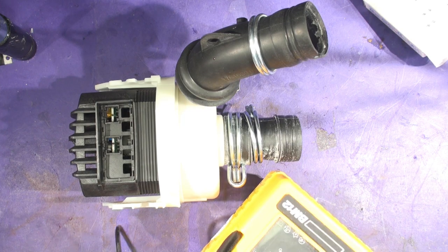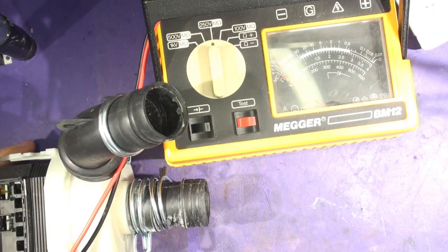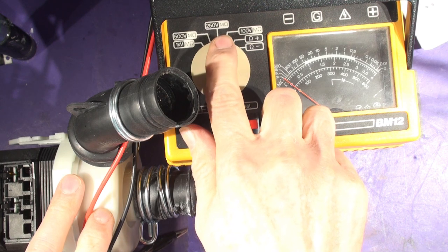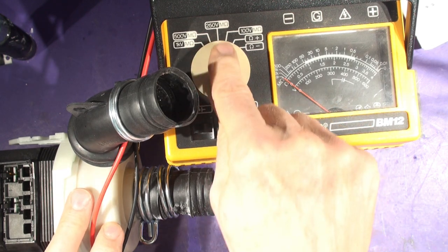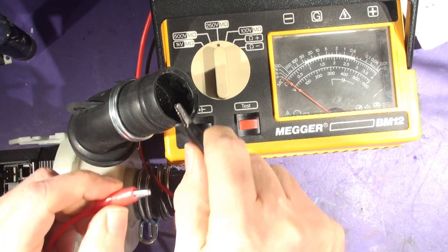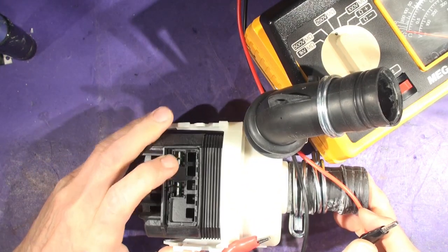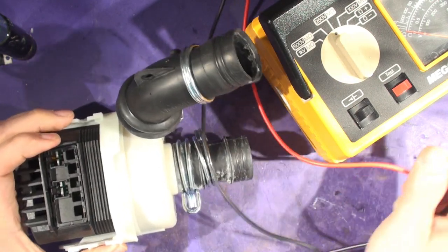What I've got here is a megger. You can see it has a 100-volt insulation test, 250-volt insulation test, and 500-volt DC insulation test. I set it to 250 volts, and when I clipped one connection on the live wire of the mains plug and one on the chassis, I was getting some leakage to ground which was throwing out the trip. I thought: there's no ground connection on the motor, just live and neutral - so how can it be leaking to ground?